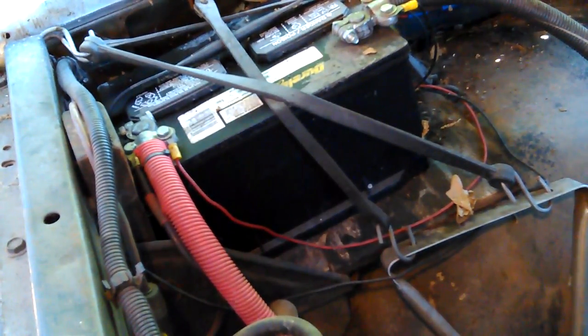Yeah. But that right there on the right, I can't get my finger in there, but you can tell by the color of the casing I put on those cables. Those are double-aught cables. Tell you what, that's something if you didn't know. I set the timing by ear to where it runs the best. Just advance the timing until it starts missing. You can do that with these older vehicles. Turn the distributor until it starts missing, and then just a little bit, and then go back just until it quits, and that's the best performance you'll get out of them.